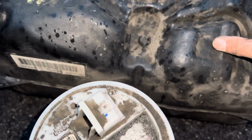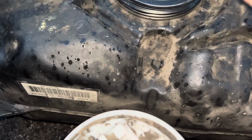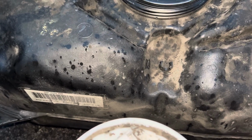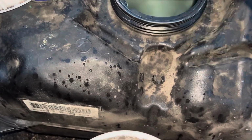Now, because it's not diesel, you won't typically need to bleed it. However, don't take my word on that. What you've got to do is just cycle the ignition 4 or 5 times, cycle it 5 times, start it on the 6th time. And I just mean taking it from the off onto the on, where all the lights on the speedo come on. You should see the fuel needle go up and down, and that'll fix your fuel issue.